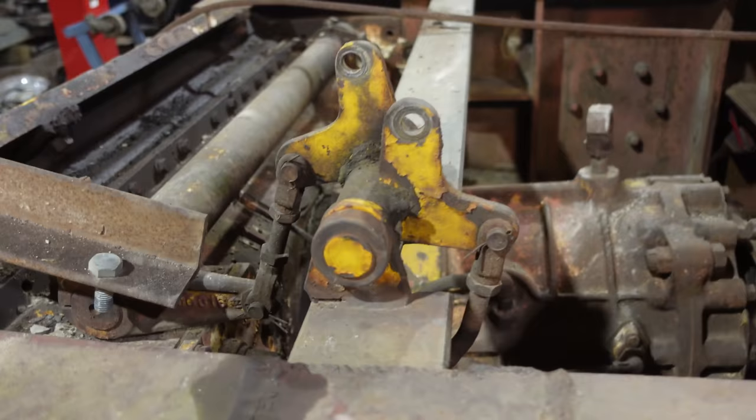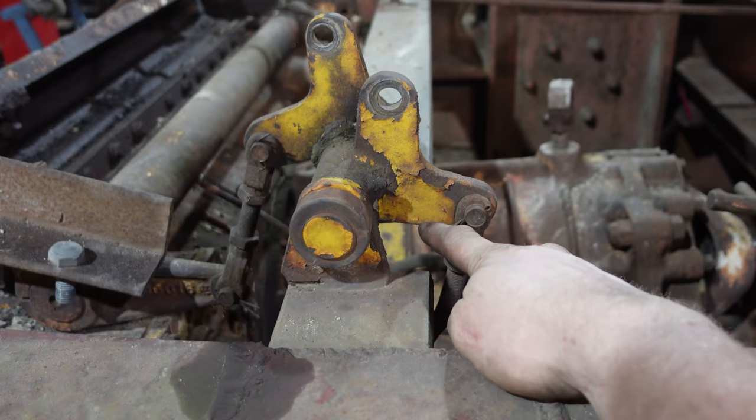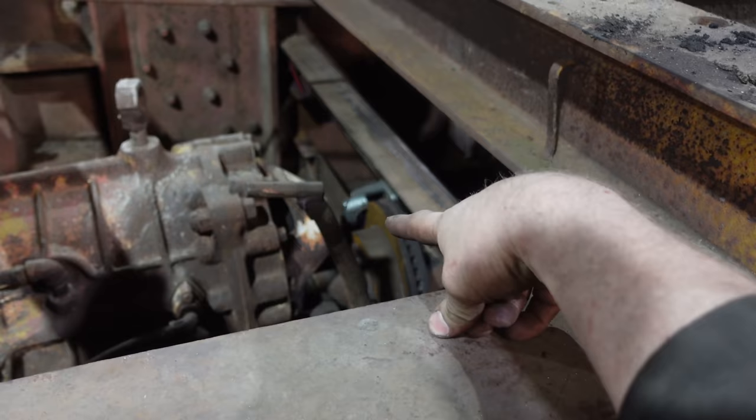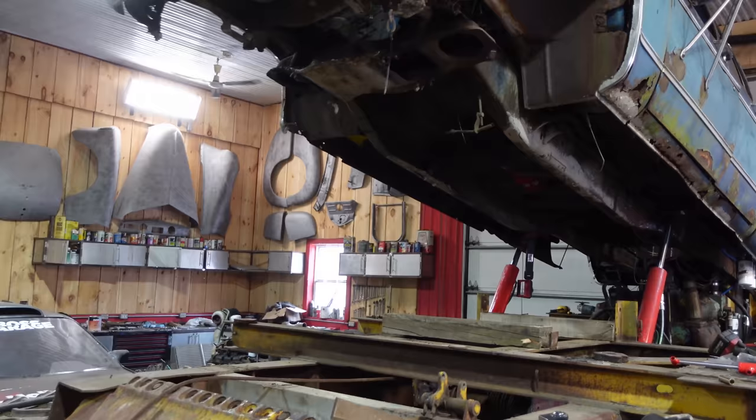So I'm going to put the safety stands on there and start working on my shifter and my brakes. I'm going to put a diverter valve on the brake master and then put two slave cylinders off a clutch underneath these levers, so that when I hit the brake, both will squeeze up at the same time. So I've got the brake on the drive shaft, and then I've got two brakes on the final drives as well. That should stop it pretty quick.